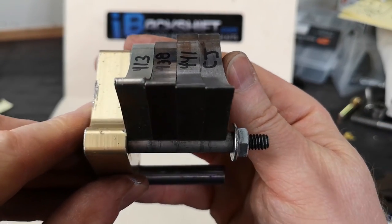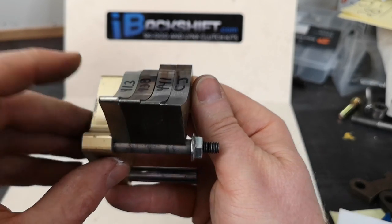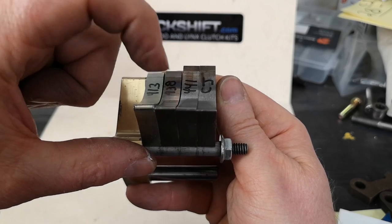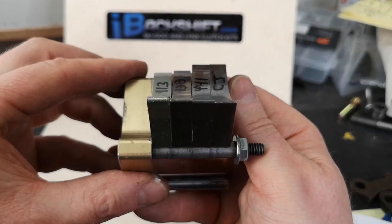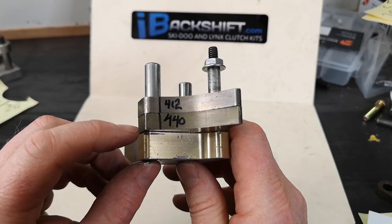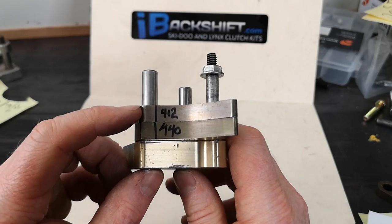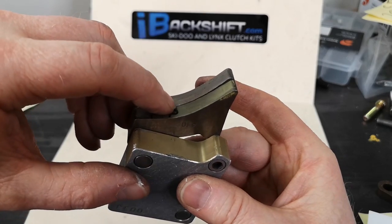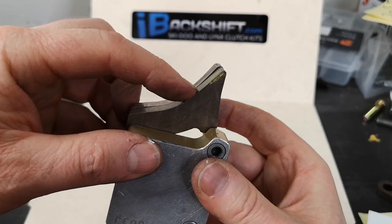Look at them like this too. Oh well, fancy that! Look how much they're laid down. This pushes X, this pushes a little bit more than this, this one pushes harder, and this one pushes the hardest yet. Here are two 600 ramps - you'll see this common in a high elevation 600, 4,000 feet and higher ETEC. This will be for the low elevation 0 to 4,000 feet. The starts are almost the same within a gnat's whisker. They go down to about half of the shift, and then towards top end, you can see the 440 pushes much harder.